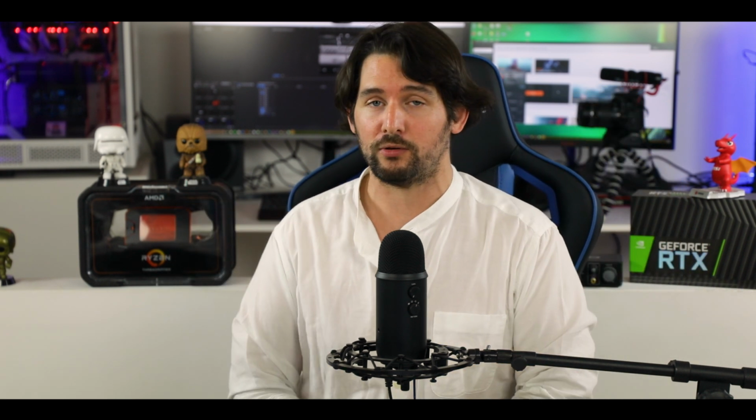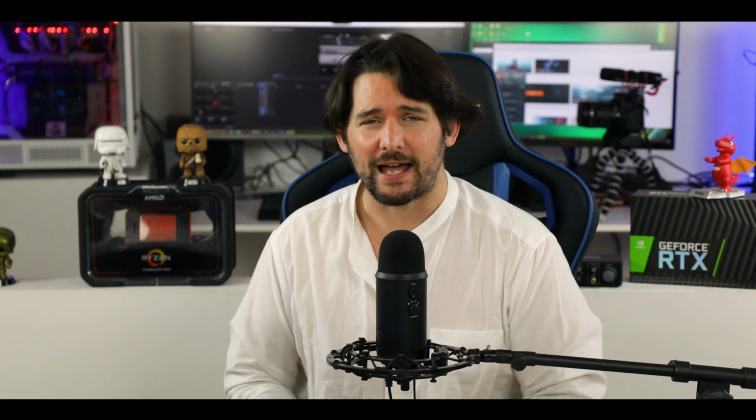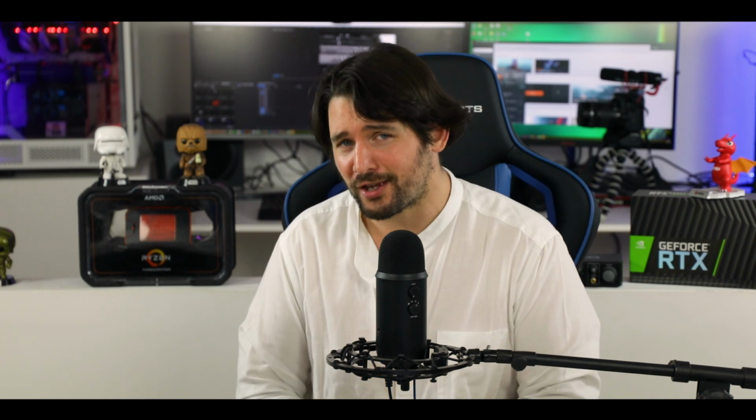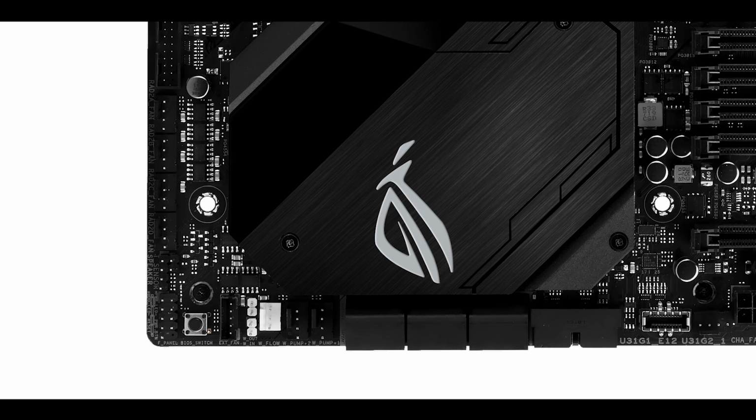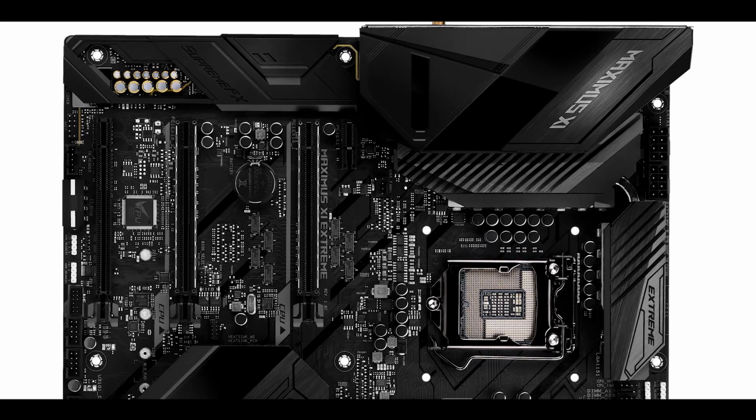So potentially, I don't know what kind of custom water cooling system you'd go with, but you would be able to run up to 16 fans on the same motherboard without any kind of splitters. Take that, environment. We have a water flow sensor, an in and out water sensor, 3 thermal sensor connectors, and finally a water block connector hidden right under our top heatsink, just in case you'd want to go completely cuckoo and install a water monoblock, just as in the Maximus IX Extreme.